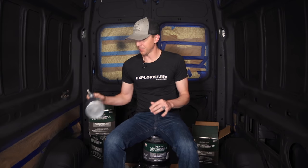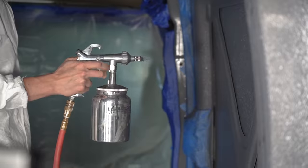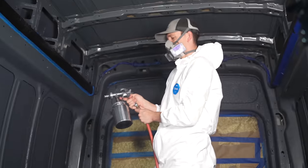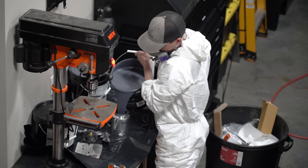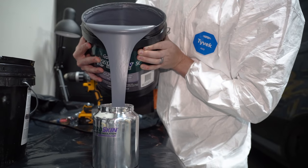Number three: that little spray cup on the bottom of the spray gun just doesn't last very long. Next time I tackle this project I'd get a second spray cup and have someone keep refilling them to keep the process moving faster — I was emptying a cup every three to four minutes, so a bulk of the time was spent getting out of the van for refills. Number four: Lizard Skin is actually pretty thick stuff, and when it cures it's pretty hard. On some threaded bolt holes we covered with painter's tape, the Lizard Skin completely covered up some of those small tape squares, and we're probably going to have to dig some of those out, which may require tapping some threads. Hopefully not, but I'm mentally preparing myself for it.